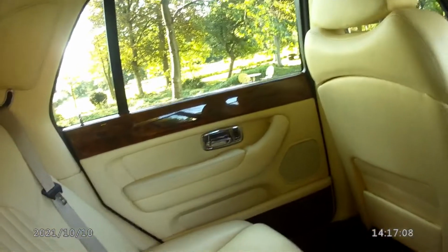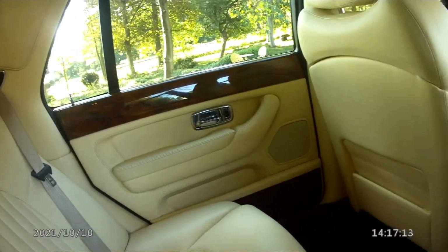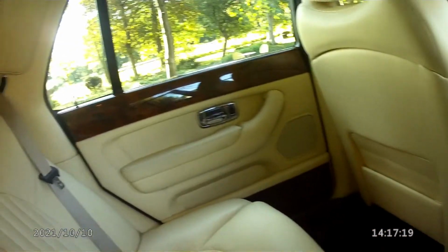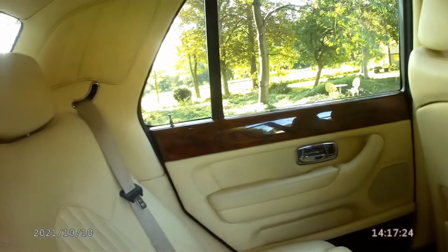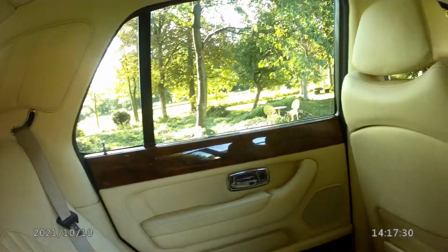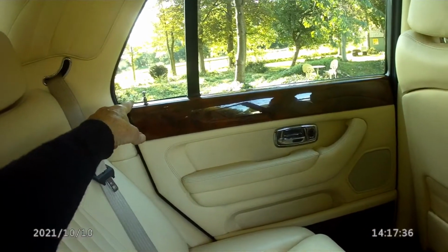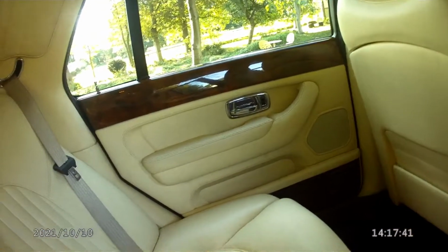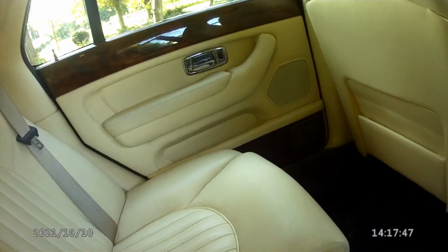The window lifters on my Cloud, and possibly the Shadow, I'm not sure, were chain driven and really sophisticated, and the window lifters on this are cable operated in a large Bowden cable. And I found that if the window on this left hand side was lifted to the maximum, it could foul the actuated mechanism for the central locking, and I didn't learn that until I stripped the whole side out, which was a bit of a palaver.